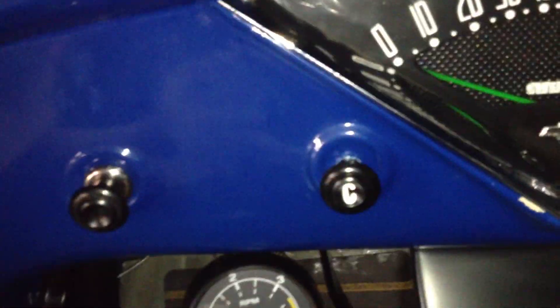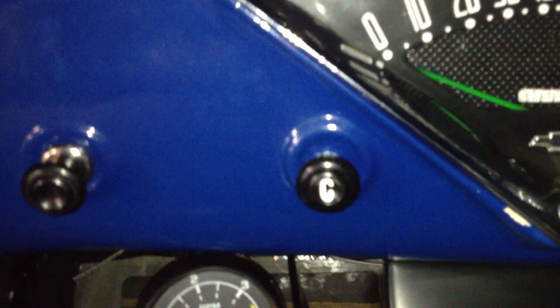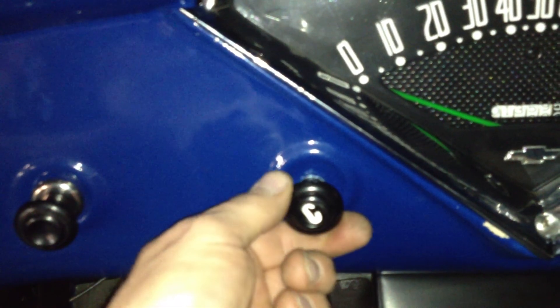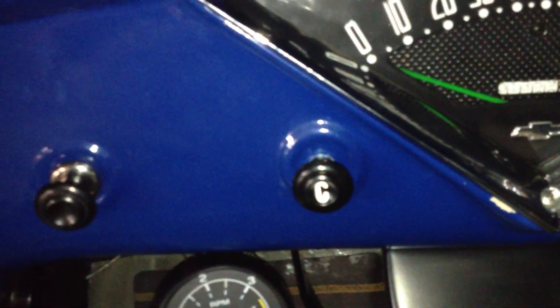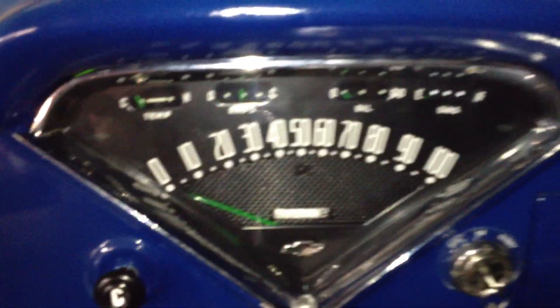Next to the headlight switch is the old choke pull knob. On these old trucks you'd press the gas pedal down once and then pull that out to choke the engine to start it. I sort of modernized that — the 'C' you see on it no longer stands for choke, it stands for computer or chip. I mounted my TS six-position chip right there, drilling out the old choke cable knob and putting a little set screw in it so it turns the chip. Laying horizontal and flat is stock position, one turn is high idle, the next is standard tow, the next — where I expect to run the truck most — is number four which is hot, and then you have Extreme A and Extreme B settings after that.